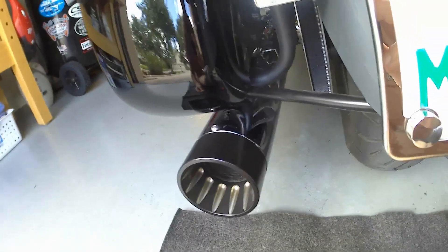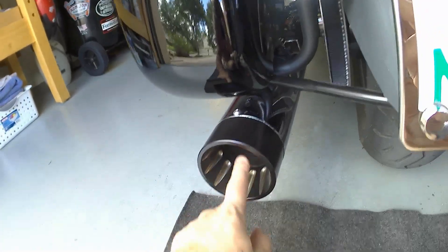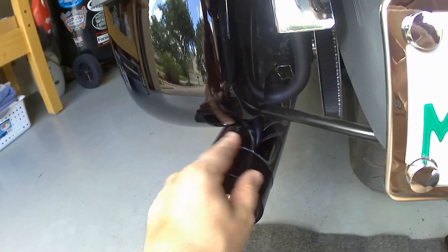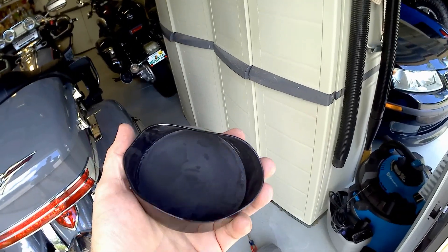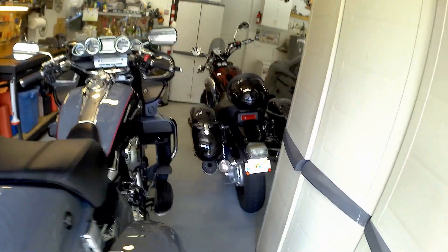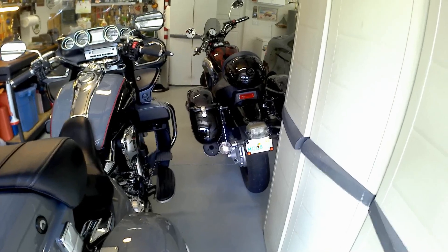You can see that's got the material in there, and of course it is rifled inside. The worst thing you can do is if you wash your bike and get water in here - it can sit and make its way in and create rust on the inside, because this is a chrome plated metal and you don't want rust to set up. What I would highly suggest is buying yourself a nice set of these. I do have plugs that fit into smaller exhausts, like on my V-Max right there, so when I wash that no water gets in. These holes here are so big I couldn't find a plug to fit, so I thought, let me take an outside diameter which was four inches and I just happened to buy this.